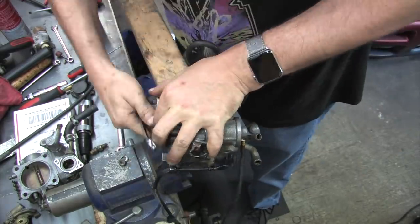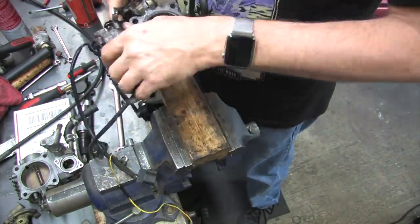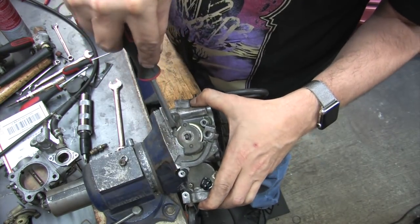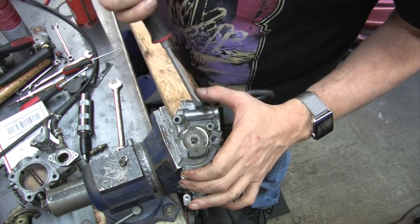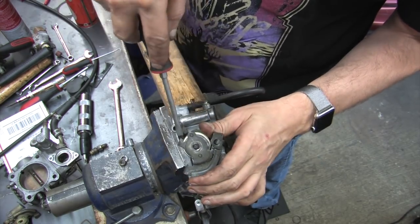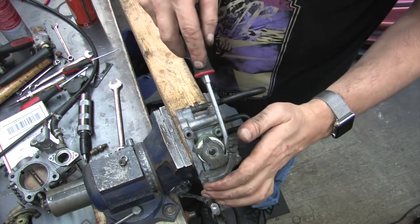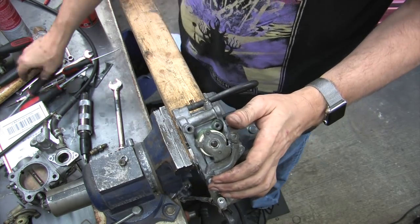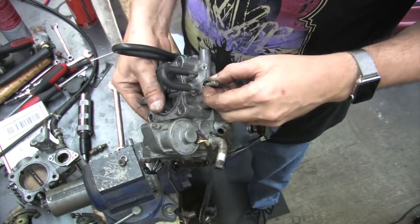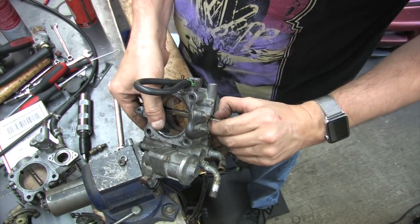It's supposed to just slide off, but the spring pressure and age can really help them stick together. Don't just pry on it to remove it, try to wiggle it, switching to opposite sides and walk it off the slotted threaded end of the throttle shaft. Once you pop it off the metal outer plate, the springs will unload and you can remove the rest of the assembly. There's a plastic spacer on the throttle position sensor side. Don't lose track of that thing, trust me.